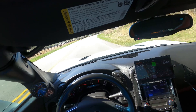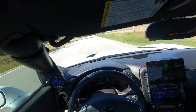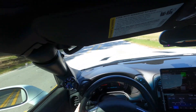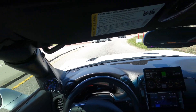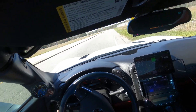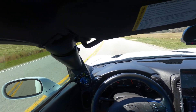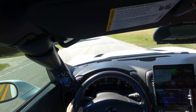Next I want to show you how the rolling anti-lag works. I have it mapped to my cruise control — with the CAN inputs you can remap them however you want. I'm not a big fan of cruise control anyway, especially not on a stick shift, and I don't do a ton of highway driving on this car, so I've used that button for rolling anti-lag. It truly is instant — you're building up boost. I'll do the same thing in third gear at 3000 RPMs: I'm going to hold the anti-lag, floor it, and you can watch it actually build boost, then when I release it, it launches.